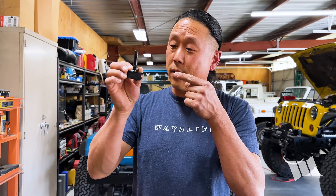With the ring off your wheel and set aside, I can now install one of these. This is a TPMS sensor, and while you can recycle the ones that are on your existing wheels, I always find it's just as easy to buy a new set and install them. There have been multiple changes over the years as to what TPMS you use, even on the same model Jeep, so it's really important to get the right ones for yours. When buying a set, it's always helpful to use a vendor that'll do a VIN check, as that'll help prevent any mistakes.